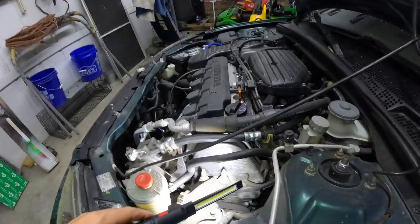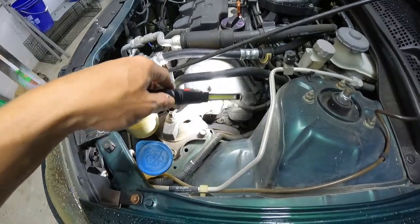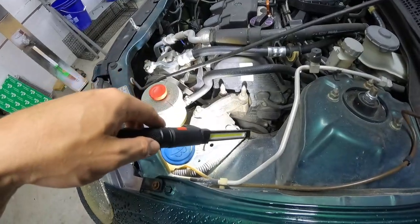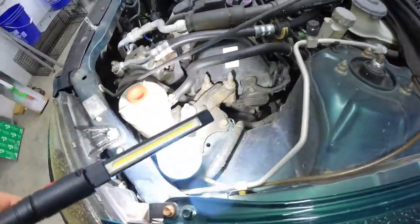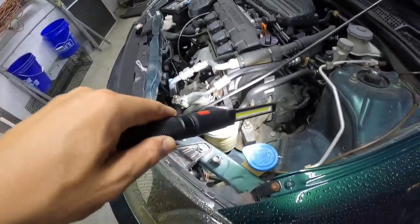What we're going to do is pull the crank pulley, then pull the timing covers off so we'll be able to get access to the sensor. That sensor should be behind the crank pulley, behind the lower timing cover. So let's get this accessory stuff off and then start getting into the heart of it.